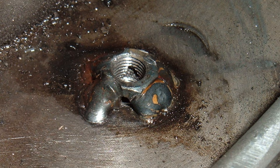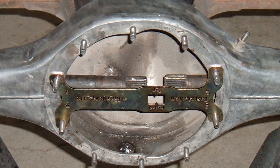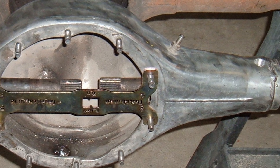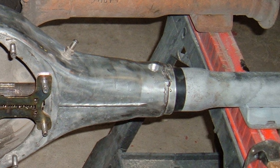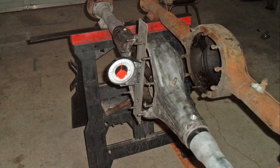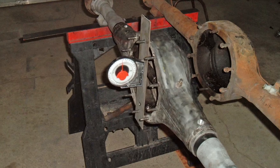From there, I was able to start the actual assembly process. The first thing I needed to do was set axle depth — this is where the dog bone comes in handy, though in retrospect I think a piece of steel jutting down between the axles would have worked better. I did each side one at a time, not worrying about pinion angle, and simply set the depth. Once I had the depth, I used tape on the 8-inch axle housing tubes to mark exactly where they needed to be in reference to the 9-inch housing they were going to be welded to.